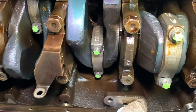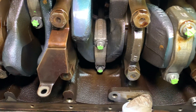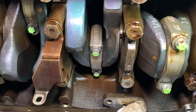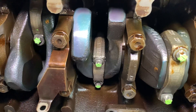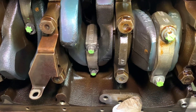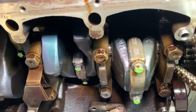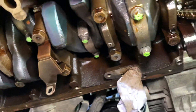These are the new BMW bolts — a very special bolt that has to be replaced because it's a stretch bolt, and there's a very special torque procedure. It's not just torquing them once; it's torque to yield, where they achieve full tensile strength through a cycle. BMW's instructions are: five newton metres, then 30 newton metres, then a 105-degree turn — that's cycle one. Then undo the bolt and repeat for cycle two, then cycle three. At that point it's achieved full tensile strength and we paint-mark the heads with a green pen.